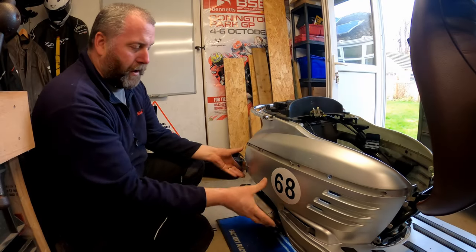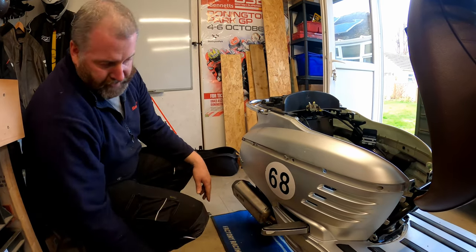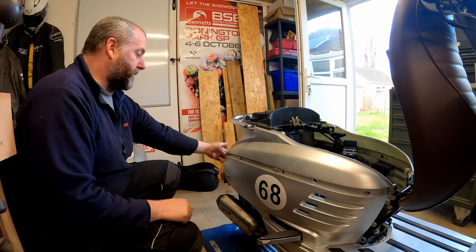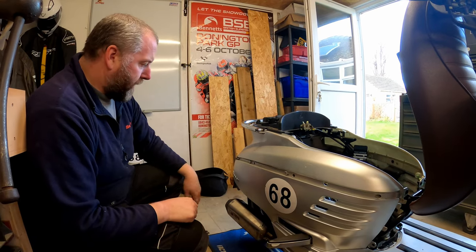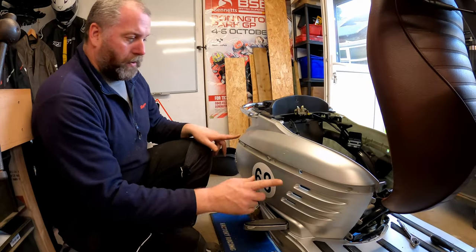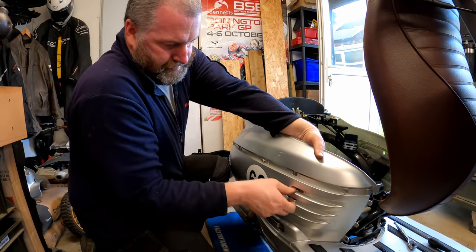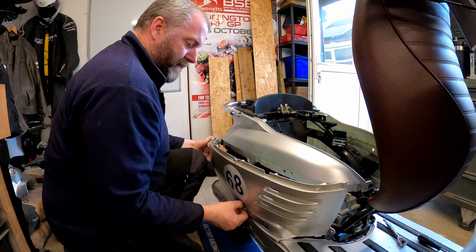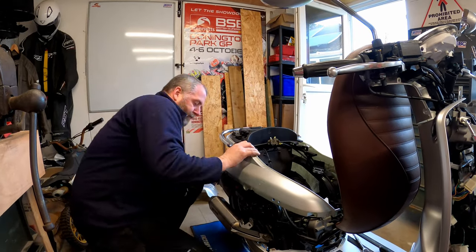To get the lower panel off, there are actually four screws there, plus one behind the footrest, another one just underneath the 'D' for Django, and then the one we uncovered at the back when we took off the little number-plate lighting panel. I'll whip all of those out and then that panel will be ready to come off — just like that. It's actually easier with the peg out slightly, and there we go — the lower fairing is removed.